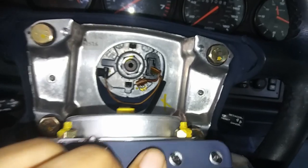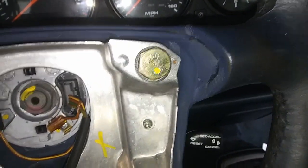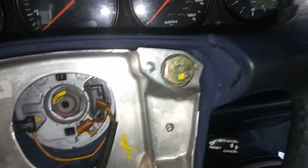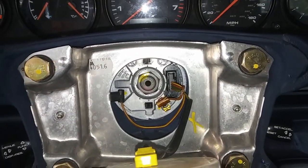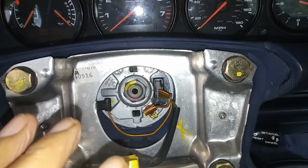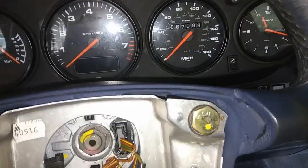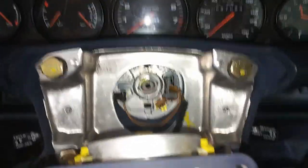That's the airbag. These are the four corners. They're supposed to be 19s, and we're going to put the O-rings there so we don't get that sensitive horn, with a $3 repair rather than changing the whole airbag. Because what I've heard is that this bracket is very hard to get, and they reissued this bracket. Of course, the holes are supposed to be shifted, so they want you to buy the whole airbag kit, which of course we're not doing.